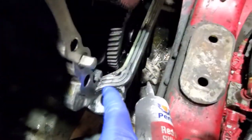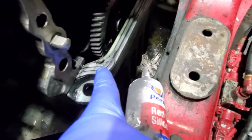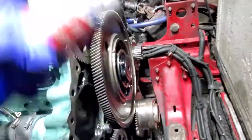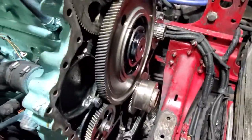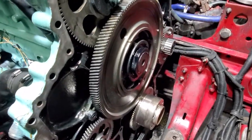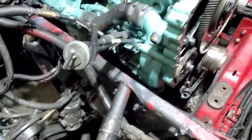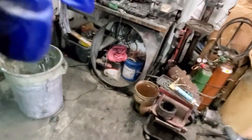When you get down to the bottom here, you're only going to go to this edge because the oil pan gasket will seal the bottom of it. I'm hoping I can get lucky on the first try with the guides. I'm going to squirt it on here — I already got it all cleaned off with brake cleaner — and then let it set up and tack up a little bit.